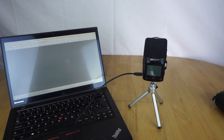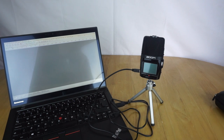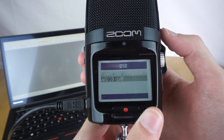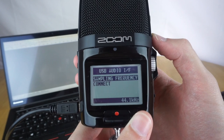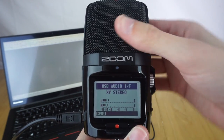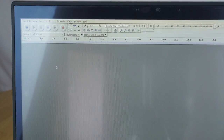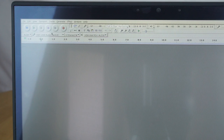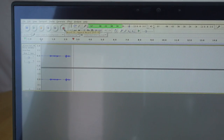Now let's take a look at the feature that sold me on this over similarly priced Tascam recorders: it can act as a USB microphone, which is actually how I'm recording this narration right now. Once you plug in the USB, the screen lets you use it as an SD card reader or pick audio interface. You can pick the sample rate and when you connect, the computer detects it as a standard USB microphone - supported out of the box under both Windows and Linux. You can then pick it as an input device in whatever audio program you're using, such as Audacity.